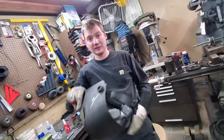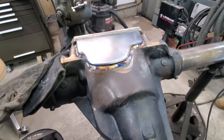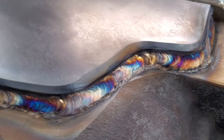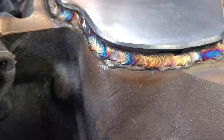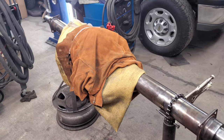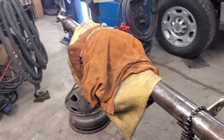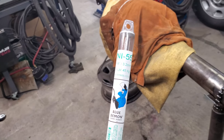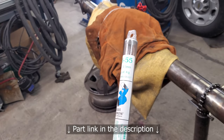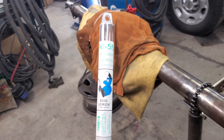How was welding that cast? It's very warm — like 300 degrees warm. It was kind of sparklery. Here it is all wrapped up — I'll let it cool down until it's fully cool. The filler rod I was using is NI-55 from Blue Demon, higher nickel content — it's what you're supposed to use when welding cast. We'll find out if it worked after it's all the way cool, hopefully no cracks.